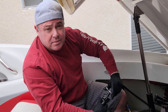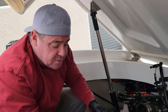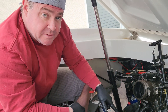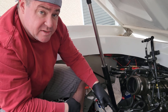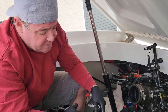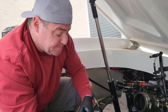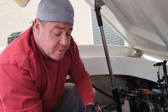So I showed you guys adding the air, depressing the valve spring, and taking the keepers out. Here's what it looks like when you're putting the valve spring back in. It's kind of a pain to do this all on camera, but the end result is the same. If you have any questions or comments, let me know and I'll be sure to answer them.